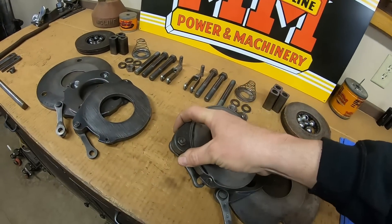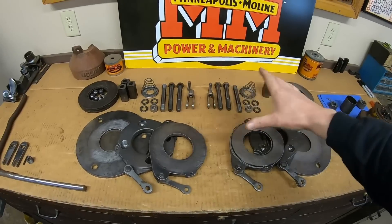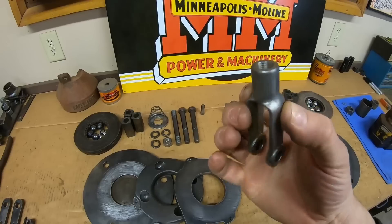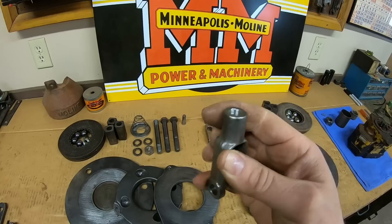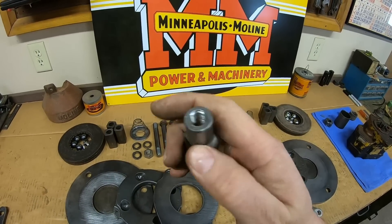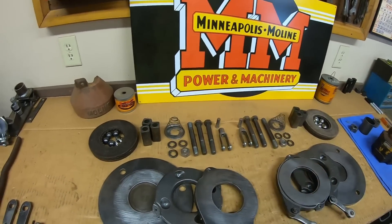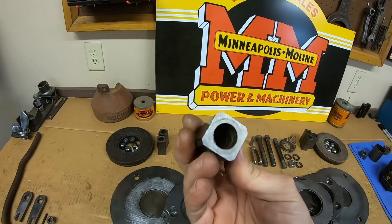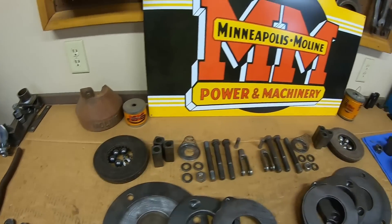Just finished with the final piece. Everything cleaned up pretty well and hardware is all good. Clevises were in good condition. You want to pay special attention to the threads inside of them because if the jam nut on the pull rod ever loosened up, it would start pulling the threads out. These are in very good condition. The standoff spacers, which are a very prototype design — we'll get into that in a bit — those are good.